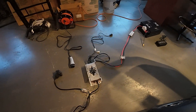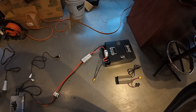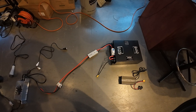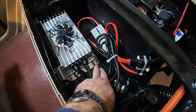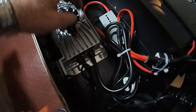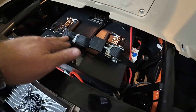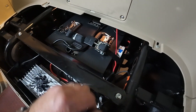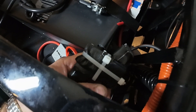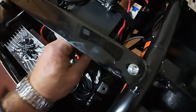It's a really easy conversion and I don't think anyone will have problems connecting it. Let me show you how I secured the battery pack. Because there's no option to secure it with just a couple screws like the charger, a ratcheting strap is my preferred choice. Get yourself a regular ratcheting strap for five bucks and secure it from underneath the metal tray. I also secured the junction box with a zip tie — everything is tight and isolated from any exposure or rubbing against metal.